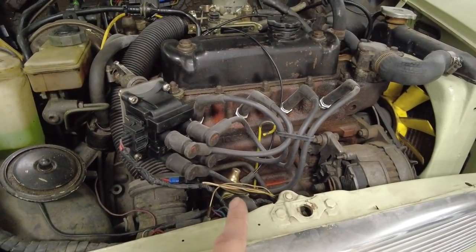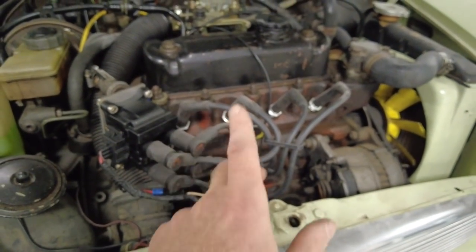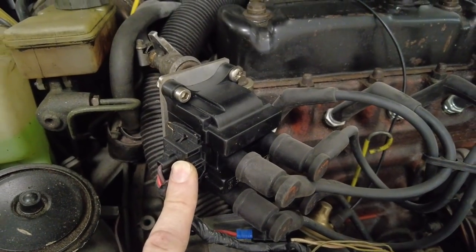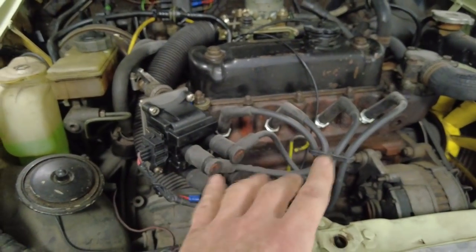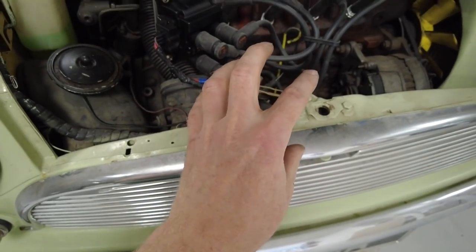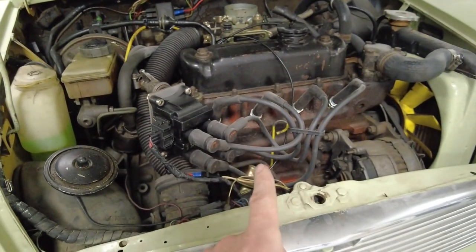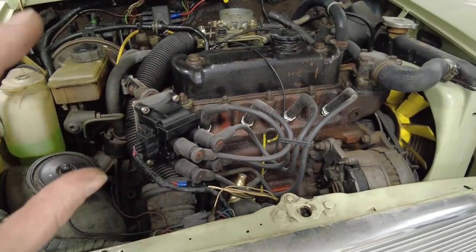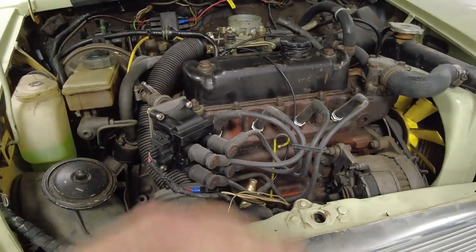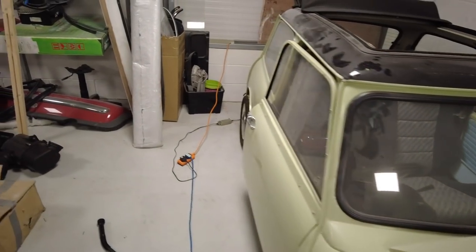The trouble is the distributor cap gets exposed to water on the front of the Mini, which is bad. So I've redesigned the distributor to have two sets of ignition points - it fires twice per cycle and fires a coil pack like they use on modern cars. I use the wasted spark system, so there's no rotor arm or distributor cap on this ignition system - just a blank cap. I should have put a patent on it. I have had distributors made with this and could actually launch it as a product, but with everything else going on I've never got around to it.